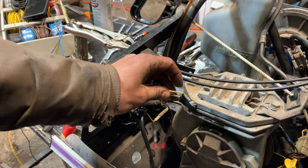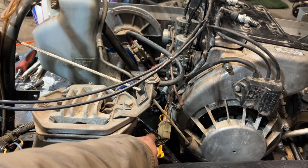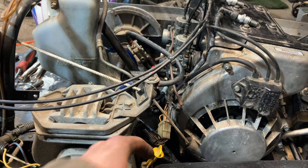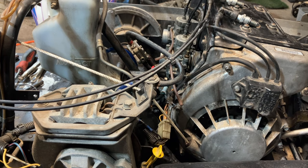This is accessories for your hot grips and other random accessories. And then, like I said, that kill switch wire is the one coming off the CDI coil unit down there. It usually has a white or cream colored bullet when they're factory from Polaris. So we just tidied that up with a new bullet connector because I had that cut for testing reasons. And that's how she's plumbed in.